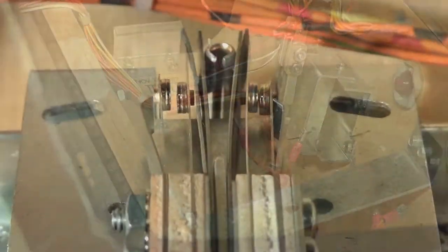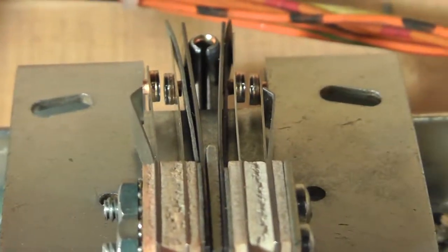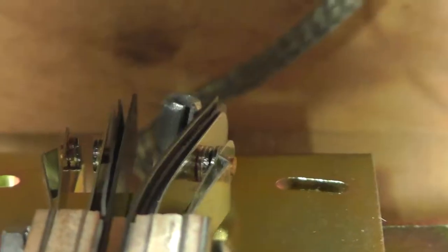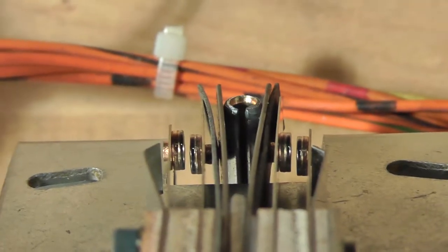This is player two — I adjusted the leaf switches. You can see that's full motion right there. It's definitely not as good. The Arcade Shop reproduction feels a lot tighter. This is player one over here — the range of motion is so much greater on the reproduction because it's tighter within the pivot. The joystick's not moving inside that pivot point at all, so it has so much more range of motion. Whereas this one — the original — I move it almost a quarter of an inch before it even makes contact.